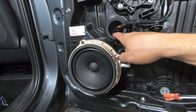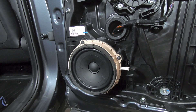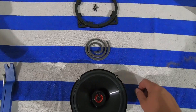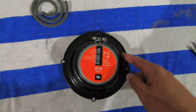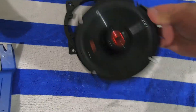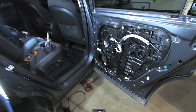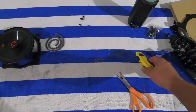To get our speaker ready, we have our bracket, screws to mount the speaker to the bracket, and our foam. Similar to the front speakers, there's a groove on the back of these 620s that takes this foam — pull the backing off and slip it right into that channel. We'll drop the speaker into the bracket, get everything tightened up, then throw it into the door. Then we'll cut a small hole in that rubber grommet with a utility knife so we can feed the wires through.